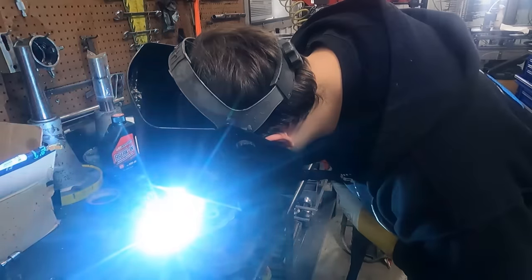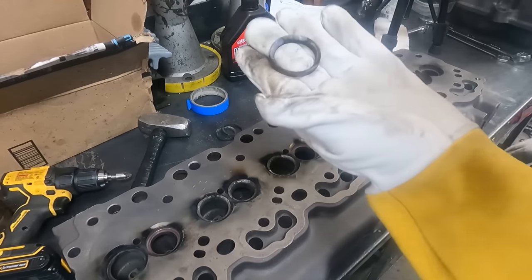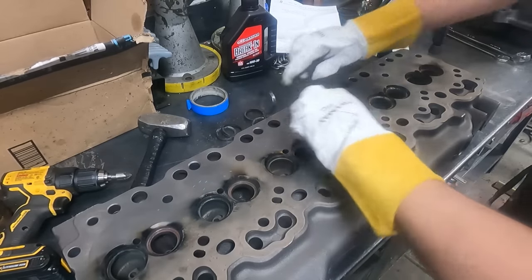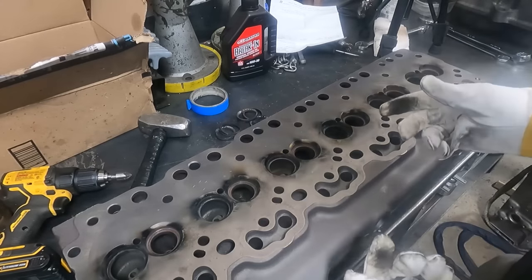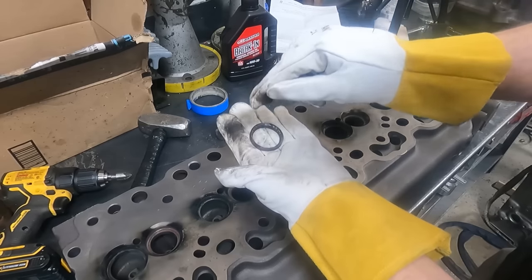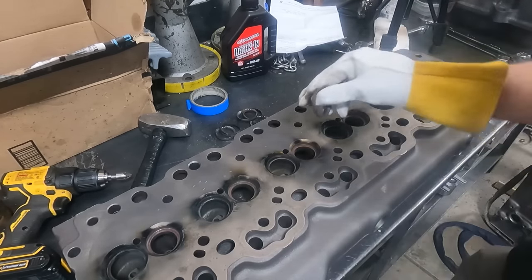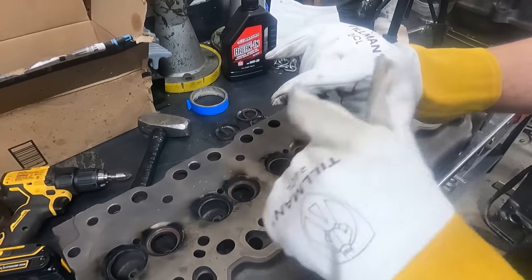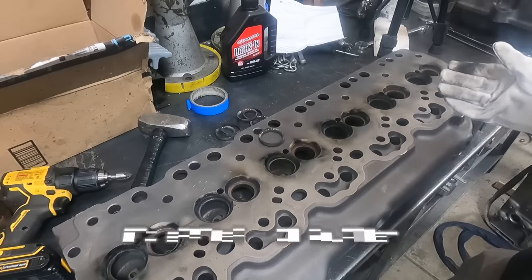Next, I finally had a chance to use my new TIG welder to try removing old valve seats that way. The welds don't look pretty at all, but the seats just fall right out after you get them that hot. Before, you've probably seen on my channel, we get a freeze plug, press it into the seat, then get the MIG welder and wire around and weld the freeze plug to it, and then go from the other side and pop them back out. But with this, there's no reason to — I don't even have to use filler wire. I just run the torch around it and they shrink enough to pop out, and there's no splatter I've got to worry about cleaning up.